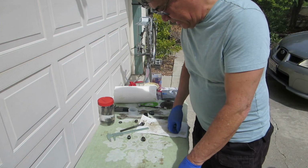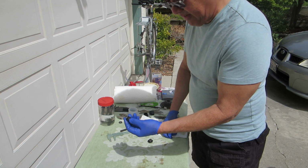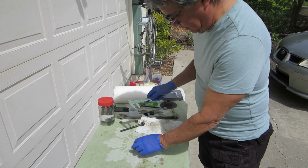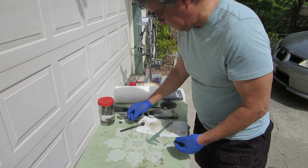Alright, so I had to take a break and buy a replacement cone. My local bike shop had the Shimano wheels manufacturing compatible product. This is 15mm total thickness, and this is 15mm. So these parts will work fine. I just use all the same spacers.